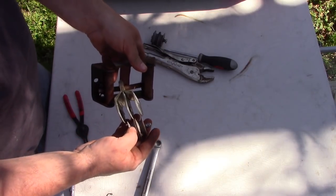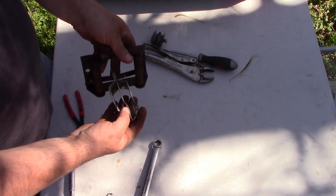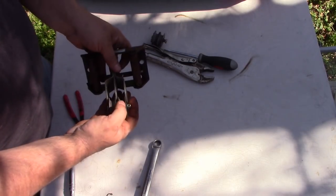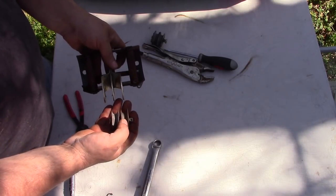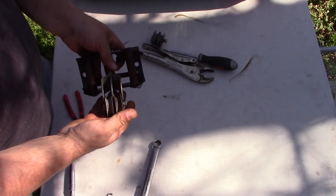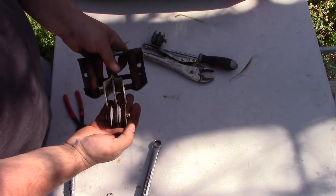These pulleys fit right here. The reason you use this pulley system is it creates a 5-to-1 mechanical advantage using the four pulleys and your anchor. So instead of that winch doing a one-to-one where it's picking up 1200 pounds, with this pulley system it'll actually break that weight down so each cable is only going to be pulling around 200 pounds or a little over. That's a lot better on the winch and also a lot better on my back.